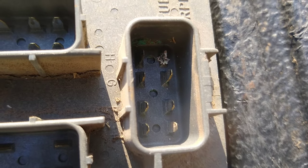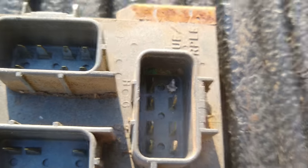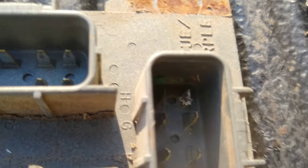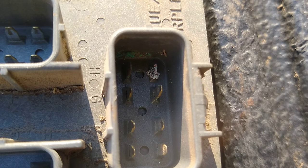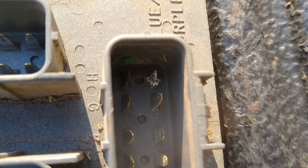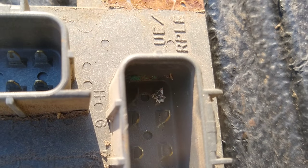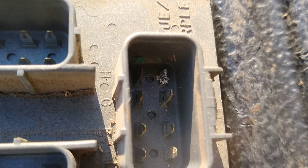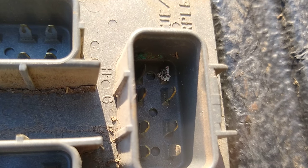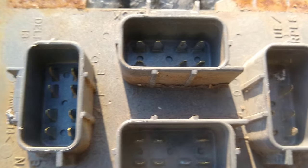What I did is I had replaced my tail lights, so I had an extra wiring harness. I pulled the pin out of the extra wiring harness and crimped it in on the connector. Then I cleaned out all the corrosion out of the blue connector, inserted that pin in there, and I replaced this board also.